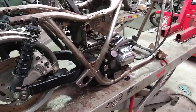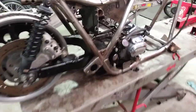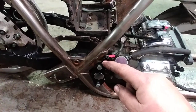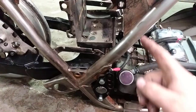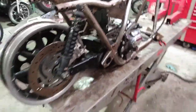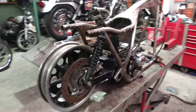That's what I have on my stretched Evo FX. I run an FLT Evo transmission and the '02-and-up swing arm — which is the same mismatch situation I was describing. The transmission in that bike is an Evo-style FLT with a pan out of a '95 or '96 — the hole is five-eighths — but I ran this type of swing arm. What I did was drill the back of the transmission out to three-quarter, then put all the stock Harley stuff in, and it worked fine. The bike has a hundred-something thousand miles on it.